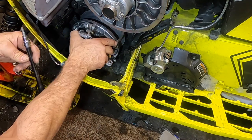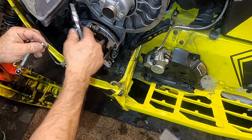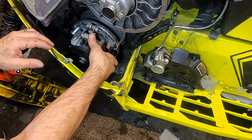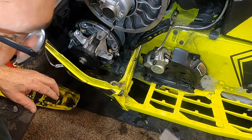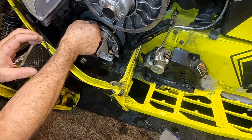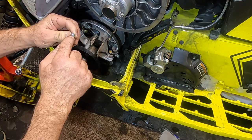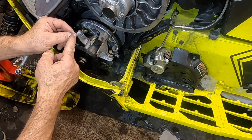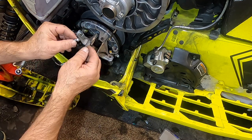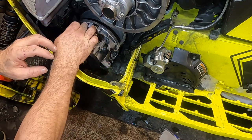The shaft that goes through here is press fit on this end. And so you gotta tap it out that way. It doesn't just come out, unfortunately. It's tempting if you don't have the right tool for it. I actually forgot my correct tool when I brought this. It's tempting to just hammer on the screw to push it out. Two problems with that I've seen happen. You can bugger up the Torx threads or the Torx bit hole on this side of that, or if you hit this hard enough, you can actually tweak the head so the head isn't perpendicular with the threads and bugger up that. Or you can mess up the thread. So try to avoid hitting the screw to punch the pin out.